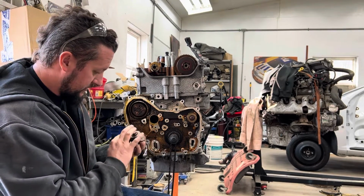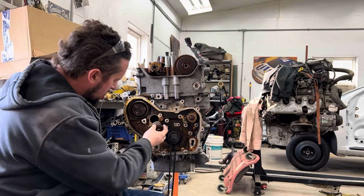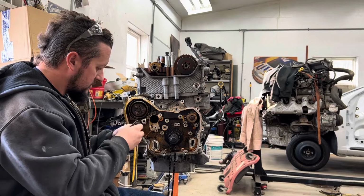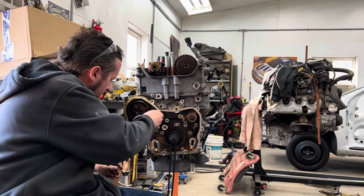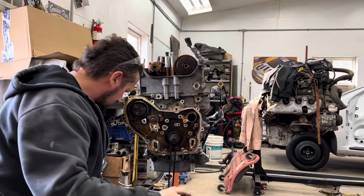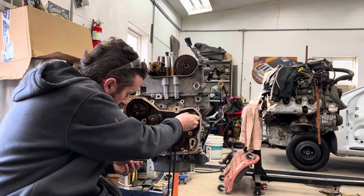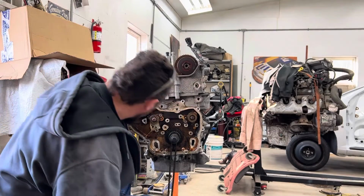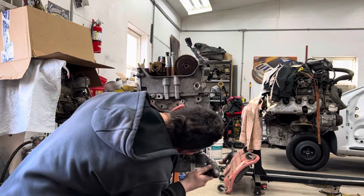So this one, you definitely can't read it. It says exhaust on it. That goes on this side where the exhaust is. Okay. Get a little oil here off my parts. That slides in there without too much of a fight. You want to get them straight, as straight as you can get them. Pull this one back out, get some oil. Oil that up a little bit. Something like that. Light taps. Make sure it's going in straight.